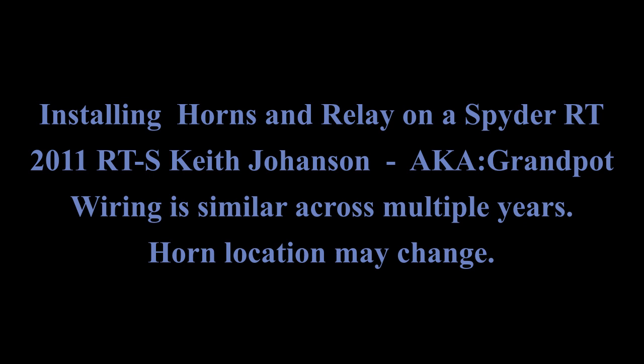There are actually two reasons why I'm doing this video. One reason is Can-Am has a different way of grounding the horn, unlike other motorcycles. The other is that the puny little horn they had on there doesn't draw much in amperage, so I'm not sure what kind of load the actual horn switch can take. So it's always safer when putting on a horn to hook up a relay. This will show you how to do it.